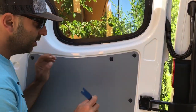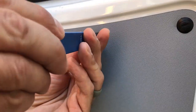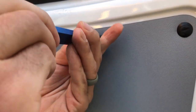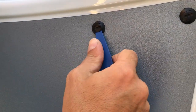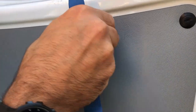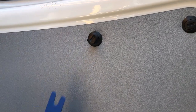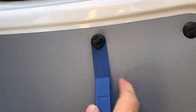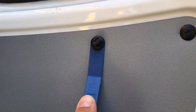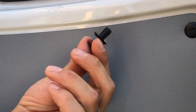If you come in a little closer, you see there's almost like a little flathead screwdriver piece there. What we're going to do is stick the other end of the tool in and twist it to the left — lefty loosen — and it kind of opens up these little gaps on the side of it. We're just going to get this plastic piece underneath and pull out on that. Once we do that, it loosens up the whole plastic rivet. That was the piece that was expanding it inside so it wouldn't pop out. Once you get that going, you can slip the other end in right underneath there and just pry it out nice and easy. And that's it — your plastic rivet is out.